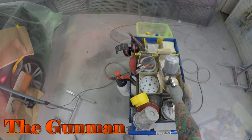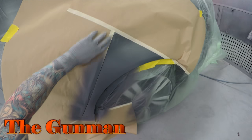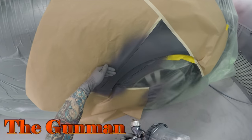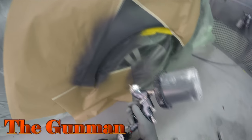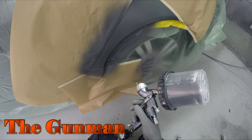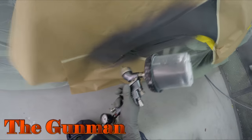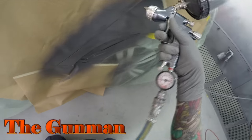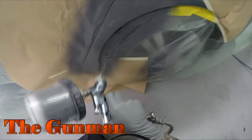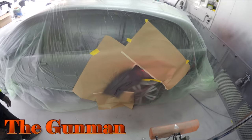You'll notice that I did pre-warm that panel. Don't want to get it too hot though — I've done it before and haven't cooled it down enough between coats and it just starts crinkling up and looking nasty. What you see me doing here is just feeling the panel to see if it's still warm, then blowing a bit of air over the top to cool it down a bit quicker. I wouldn't blow air over a fresh two-pack primer straight after putting it down — you want it to eggshell over first. Put your coat on, lights on for five or so minutes, come back, cool it down, then put your next coat on.